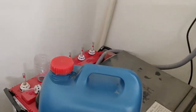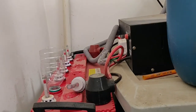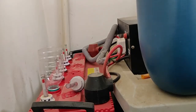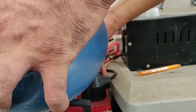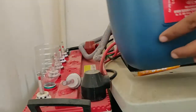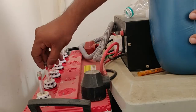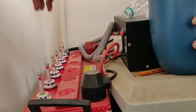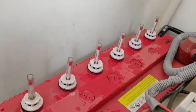Once you have fitted the funnel, pour in gently. What you want to do is check the levels multiple times as you pour — so pour a bit, get a sense of the level, then take the float and insert it back just by screwing it loosely to get a rough idea. You don't need to tighten it fully, just place it as it is. Repeat the same process for all cells.